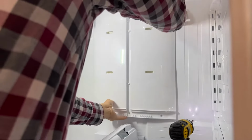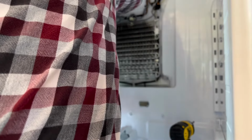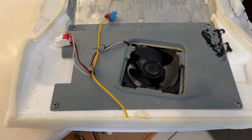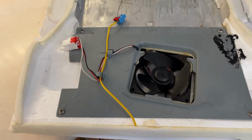After you take off the old screws, gently shake the panel. Remember there are tabs on both sides, and gradually shake it and take it out. There are 2 wire connectors on the upper left corner. Press the connector's tab, remove the connector, and then take the panel out. I replace the temperature sensor, the thermistor for the fridge compartment.